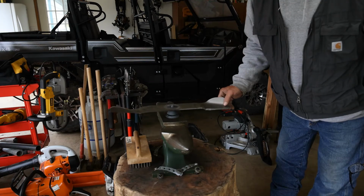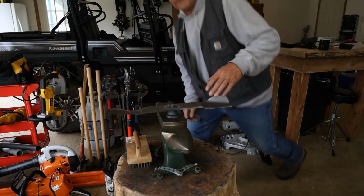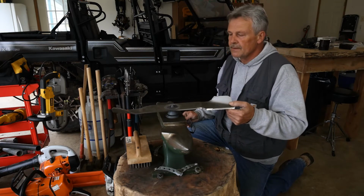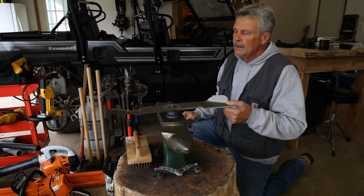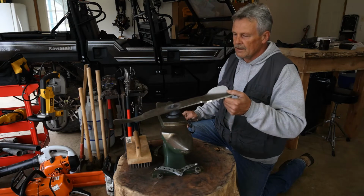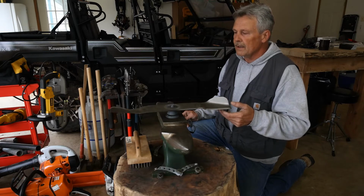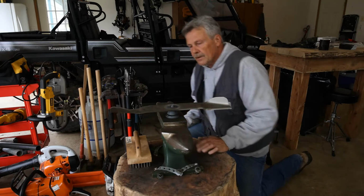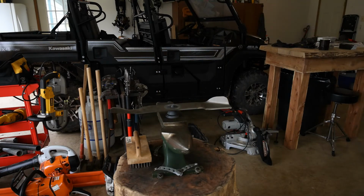And we will keep this thing absolutely dead level. Now this is one of those things, if you think about it, it's hard telling how many revolutions this is making underneath your mower as you mow your yard. So if you have one that's out of balance, specifically if it's tipping real far, then it's just going to cause excessive wear on your bearings on the mower deck. So keeping these things pretty well balanced will be in your favor.